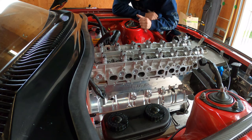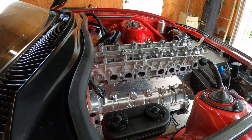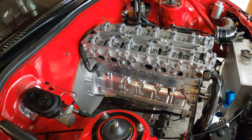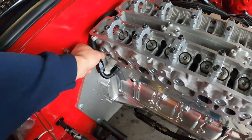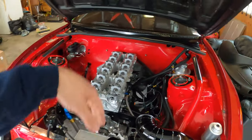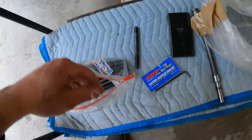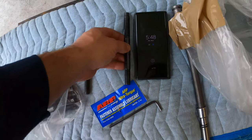Sweet, it's in place. Let's put the rest of the head studs and the rest of the inserts. I always put one stud in first just to guide it — that way when you put the head in it's all set to go. It got a little stuck on this cooling hose, but it clears. Man, it looks good. So let's put the rest of the head studs in. These head studs are massive — longer than my phone, and that's a Note 10, that's a big phone.